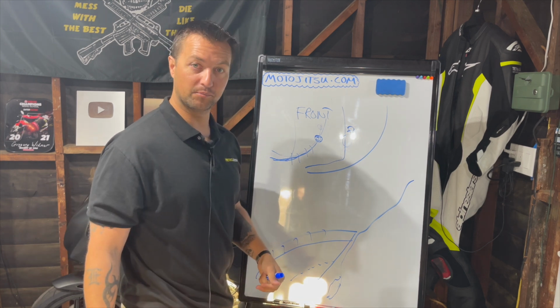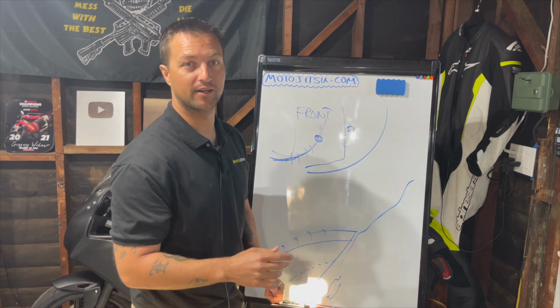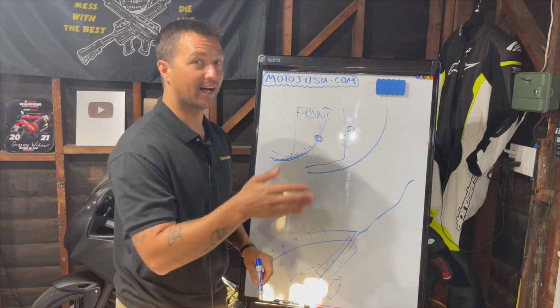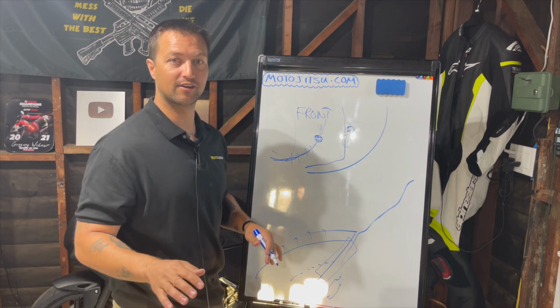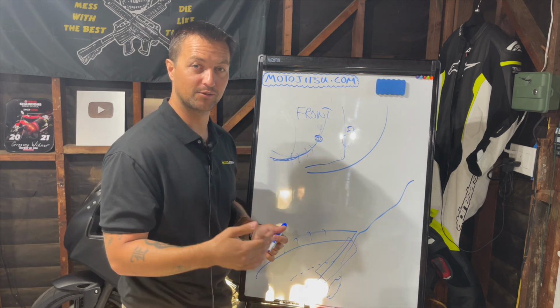The rear tire locks up, you start to skid with only 30% or less power, and it takes you forever to damn stop the bike. This is very, very common. Big, thick, black line sliding straight. Your rear tire should never skid. Your rear ABS should never engage, ever. Why would it ever engage? Unless you're purposely practicing to see what it feels like.